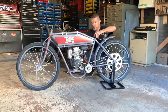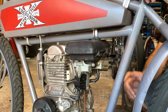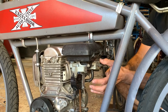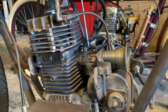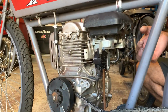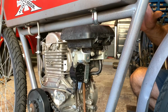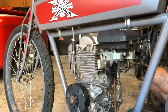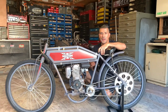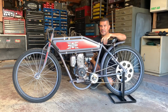The other thing is the intake. And this one is, again, modest because it has the original plastic box here that has an air filter in it. What I've done on some of the others is take this air box completely off, and put an air horn on, the way the original ones were. And yes, you have less of a filtration system. You can put foam and make a custom one in there, or as long as you're not in a sandy, dusty area, it's going to be just fine. But it will also allow the engine, as a pump, to perform even more efficiently. So it does add more to it, and of course you're going to add a little bit of horsepower. I've never dynoed one of these before, but it will add some performance that you should consider if you are really trying to take it to the next level.